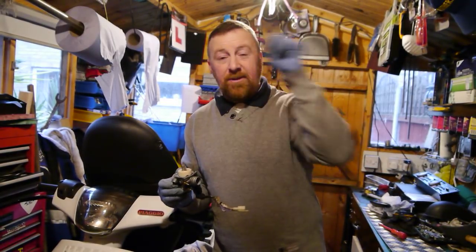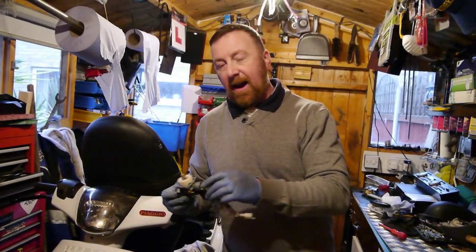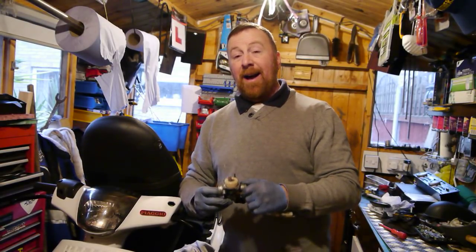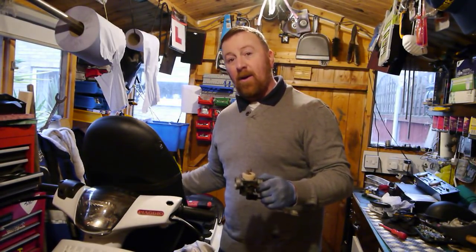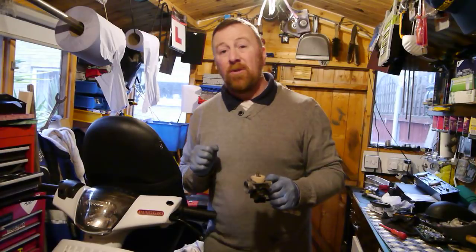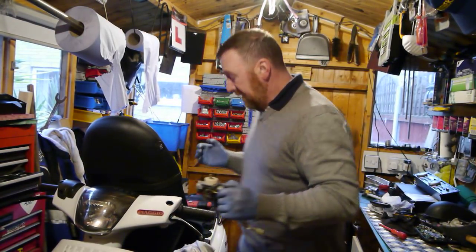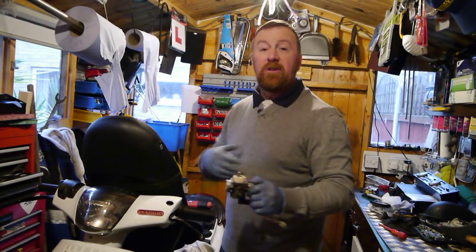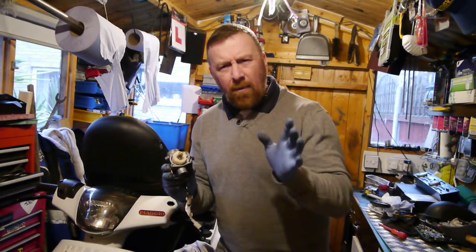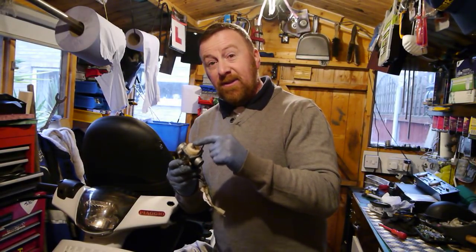Like and subscribe, and check out the carb video and the couple of bits about upjetting. I just want to say this to you guys today about upjetting: don't just whack a big fat jet in there and think your bike will run better. Unless it's got a sports exhaust to help the gases out, and you can adjust the airflow in, you're just going to cause yourself pain. If anything, you can cause the bike to go slower — poor pull away. You open the throttle and you're not going anywhere. Then you think it's the variator and you change the variator, and you're in this little cycle where you're never going to get it right. All because I didn't check the 68 jet. I had it in my mind that the exhaust was really new and it must have had the sports exhaust on there, but I didn't see that it was upjetted.